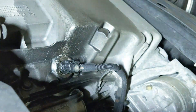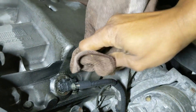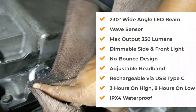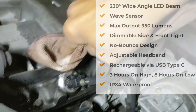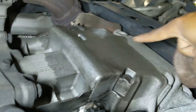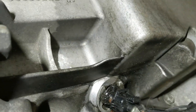Let's get to work. Underneath the Regal GS — look at that, light on. It looks like that sensor might be leaking a little bit. That's the oil level sensor — it looks like it might have a little bit of a leak. We'll clean that up and I'll keep an eye on that. I can see a little discoloration on the oil pan where the oil has been seeping out — definitely got some oil seeping up there. We'll keep an eye on that.